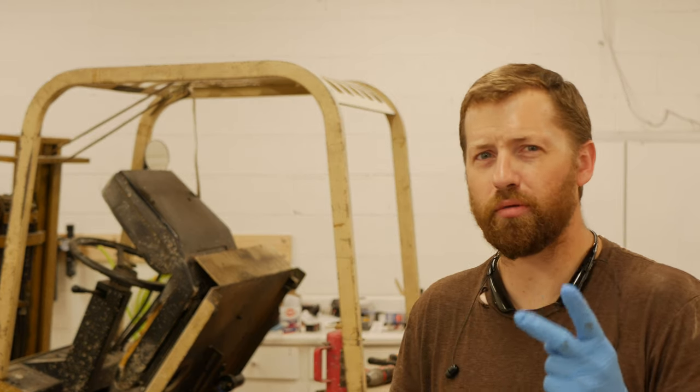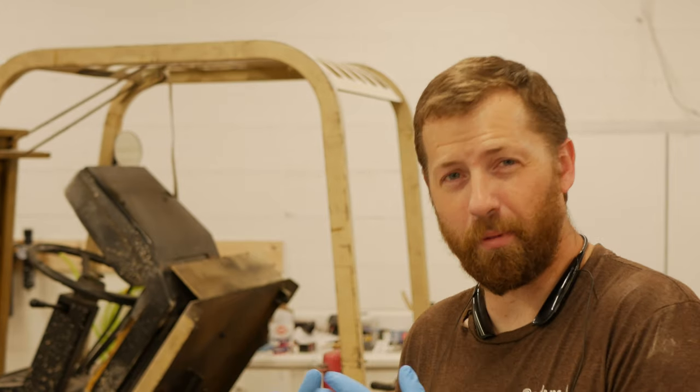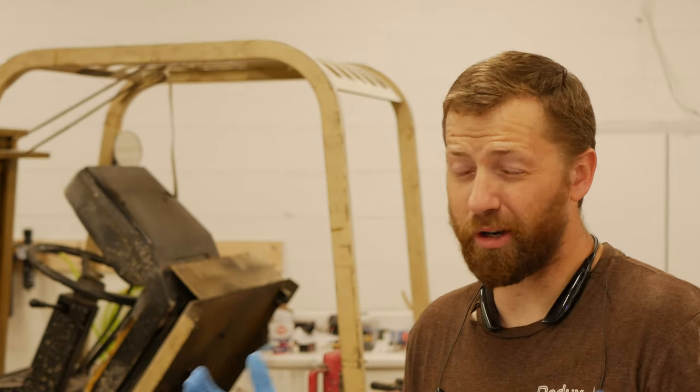The capacitor condenser appeared to be bad, as well as the points were worn. So those two components were probably the root cause for my intermittent skip on this thing before. It would run great for 30 seconds and then it would just start spitting and sputtering and stumble and fall on its face. As soon as you would put it in gear, it would just die immediately. So I checked all that stuff out to make sure that I didn't have any bigger issues going on.